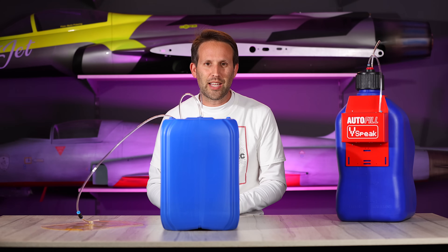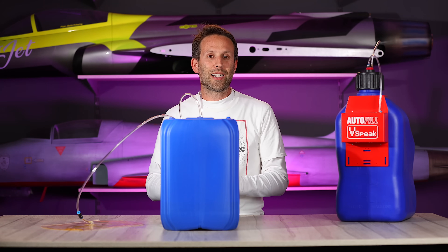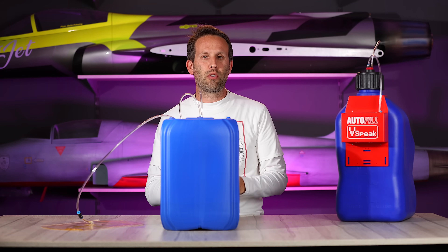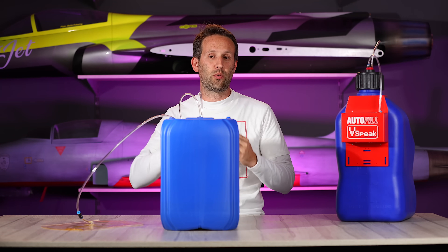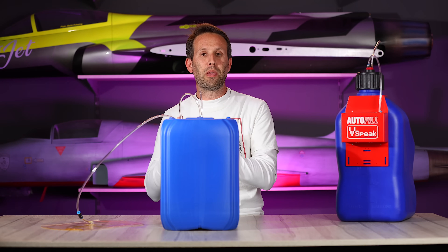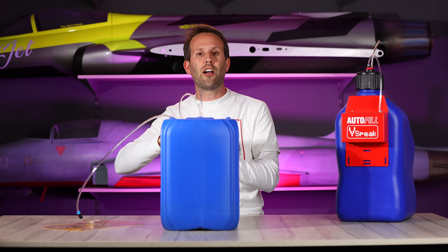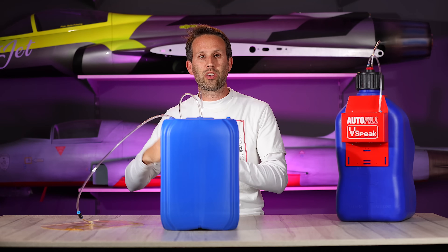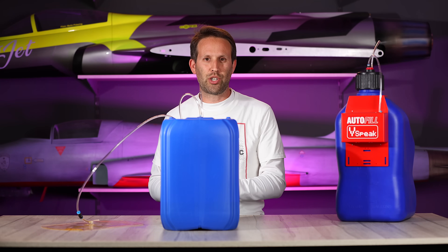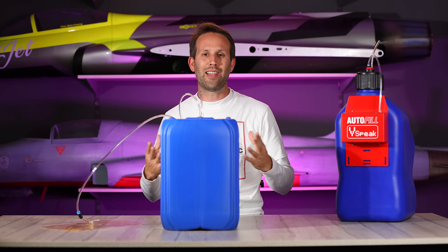The reason why it differentiates here is that if you have two fuel tanks in a row, there's a difference in pressure between filling the first one and filling the second one. To avoid false readings, when it fills the first one, it knows that the change of pressure isn't because the whole tank is full — it's because the first tank is full. It will then start filling the second tank. And once that one is full and the pressure changes again, it knows that second change of pressure means the entire tank system is full and it can now stop filling.